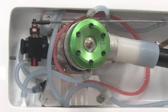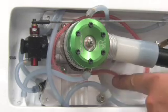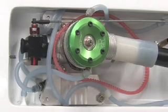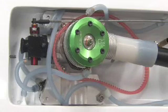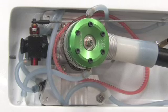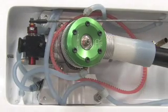Here's a close-up of the engine and the engine mount. Depending on what engine mount you go with, if you go with the AccuTech hardware, I made some wood blocks — they're very difficult to see because they're painted the same color as the engine well — but there are two wood engine blocks that this engine mount is sitting on, and it's bolted through the bottom of the hull. It's sitting on four rubber isolators, but the motor's in there pretty stiff so you don't have to worry about a lot of vibration on this particular engine mount.